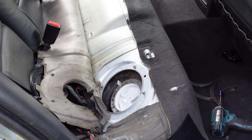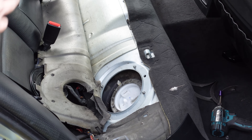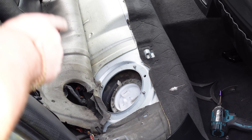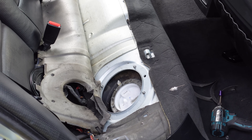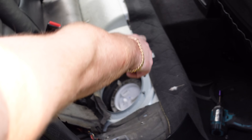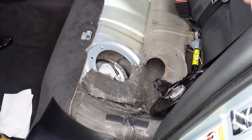Now the fuel pump is back in place and I have secured it down. When you run the fuel pump, it has got a big long hose on it that runs to the other side — you're going to want to stick that long hose up through the side there and around. There's a gap — you'll feel a tube coming out on the fuel filter side; that's the hole where you're going to run the wires up through the back and round to the fuel filter side. It will help if you do have an extra pair of hands to grab it from the other side, as the hose is a bit kinked and crooked going through there.